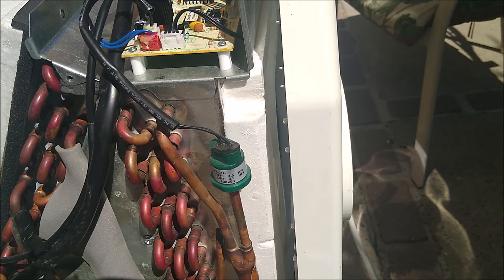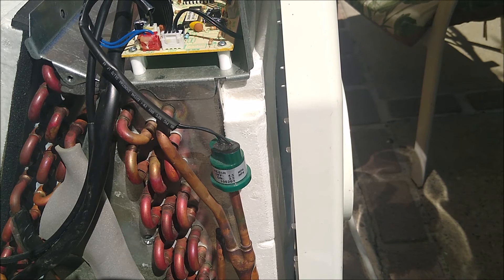If it's working — and it should work — then you've corrected the condition and you're ready to assemble the thing. What I would do is let it run for a long period of time. I let this run for hours. I did notice that it blew out a lot of cold air right out of here — I could feel the cold air coming out, and it was really cold. But then after a while it was blowing ambient air, and I thought it had failed. But I looked and saw there was no E4 code on there. Apparently this is when it shuts down — it has a long cycle period before it comes back on again. So don't let that fool you into thinking you haven't fixed it. If there's no code, just let it run for a while and it comes back. And it did.